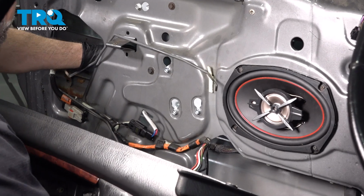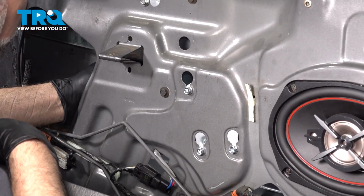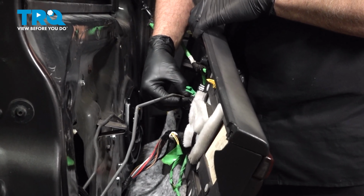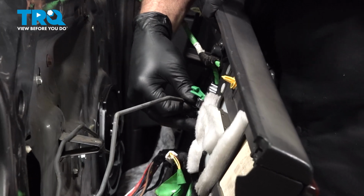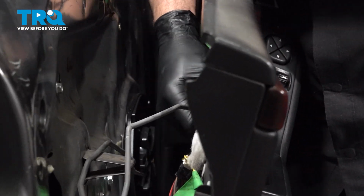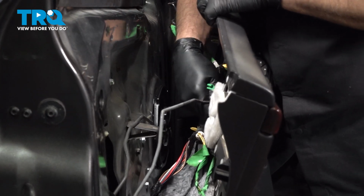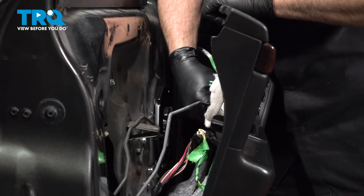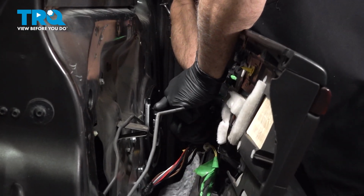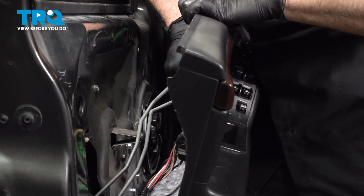Go ahead and raise it up so we can get behind and get that clip installed. All right, we have both of those clips installed. Install our lower rod. Sometimes the angle of the door panel, if you adjust the door a little bit, the rod will pop right into place. And then fold your clasp on over. And then pop the clasp back onto that one.